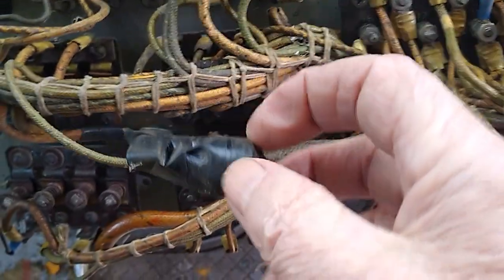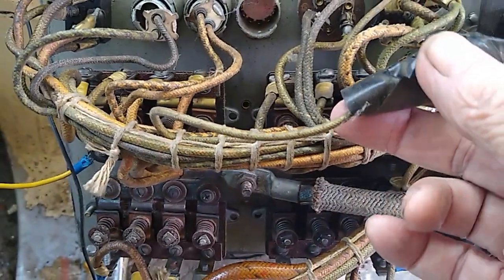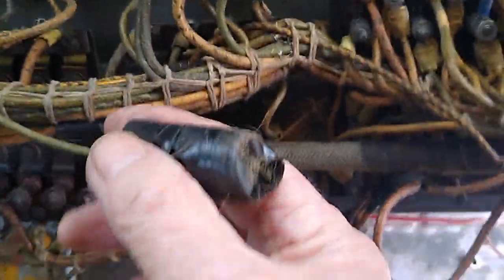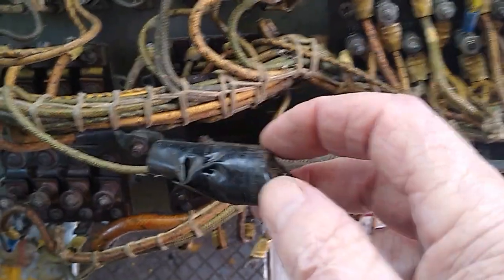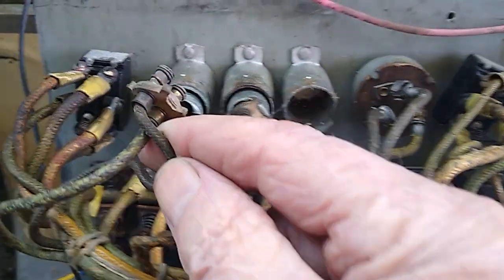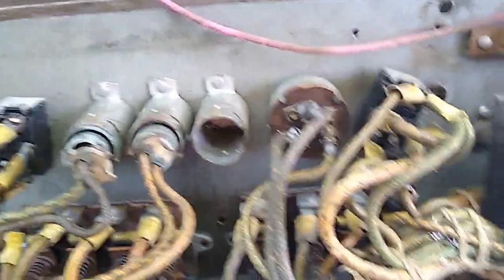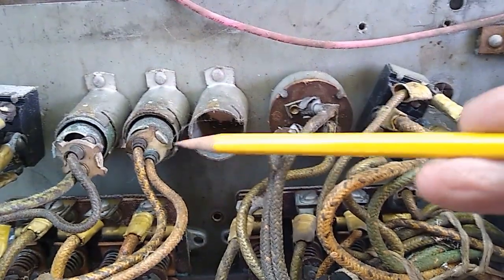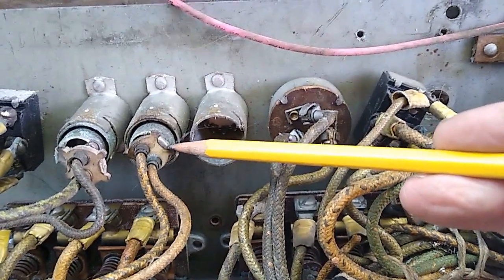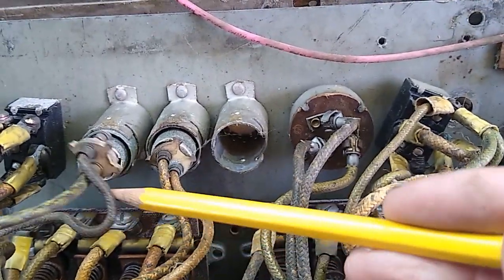Through the life of the bus, things like this show up. You can see this is one of the original wires, but I have no idea right now what that wire was. This is a common problem with the telltale lights — the little Bakelite pieces break free from the metal clips. This is a very common problem and it's very easy to fix.